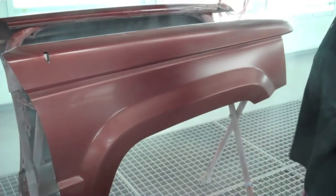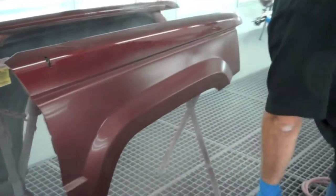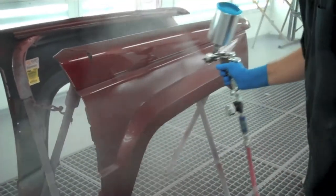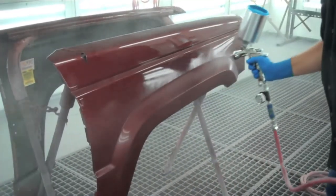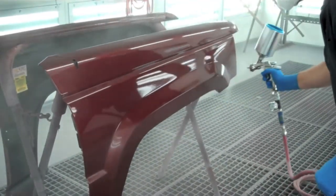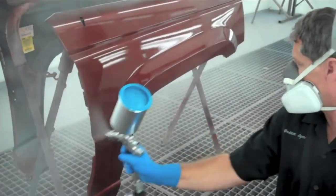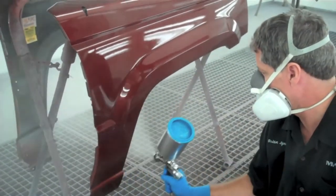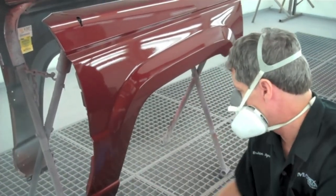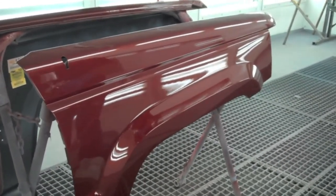I hope you picked up a couple of tips from this. The key takeaway is: let the product do the work. If you have the right reducer selection and the right hardener selection for the job size and temperature range, spraying should be easy and fun. You shouldn't have to work to get base coat to level out or to get the metallic right — it should want to do it itself. Clear coats should want to flow, stay wet a little bit after you leave, and let the solvent do the work. We have the proper selection — it's up to you to make the right choices. Hope you enjoy spraying.